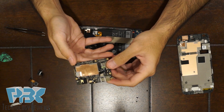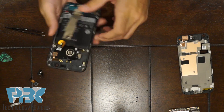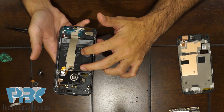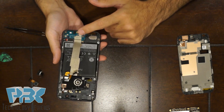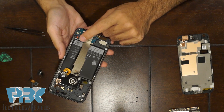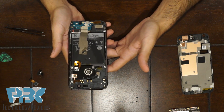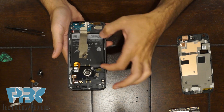So here's your main board. And you have the housing, the fingerprint reader, the battery. Down here you have your speaker and your charger port, and here's your vibrator over here. Now in order to remove your battery, you would have to heat up the back of the phone to heat up the adhesive that's underneath the battery, and then pry the battery up.